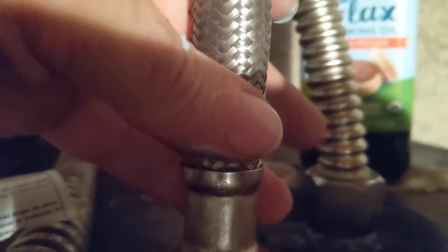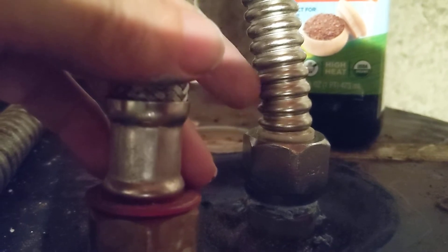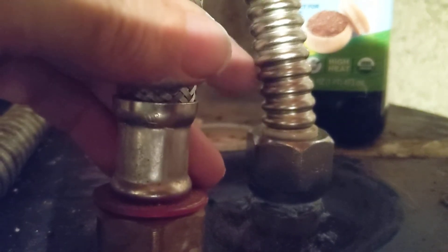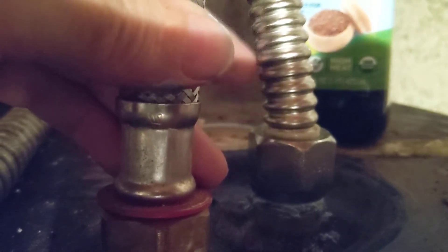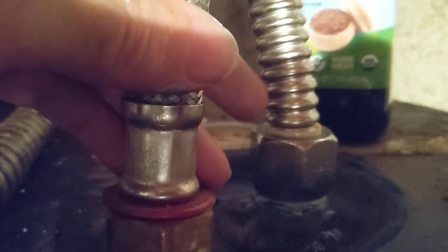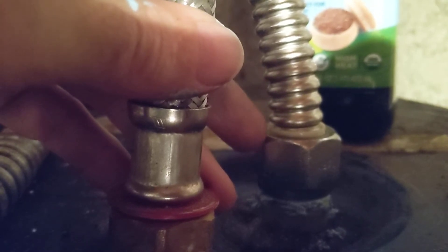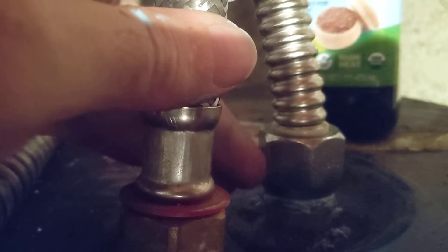I would really prefer that there be some sort of hard fitting or crimped fitting if they're doing a union fitting. This is what brake lines do. Not the end of the world, but brake lines also don't bend immediately at the union joint — the union joint would join way out inside the bell housing, pressed together and straight for more than half the nut. This is only straight right here at the top edge — that's where the flare is, at the top edge of the nut. That's a strange experience for anxiety.